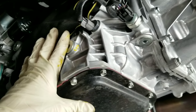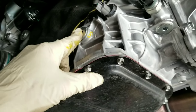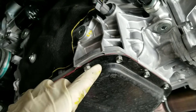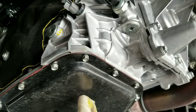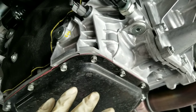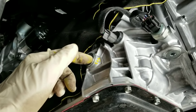Get the engine warmed up, fill the CVT, then warm the transmission to about 100 degrees. You can use a temperature gun — it should be in the 95 to 120 degree range. Then open the level plug and wait for fluid to trickle out.